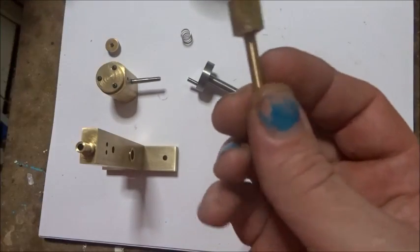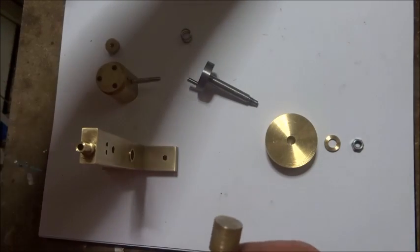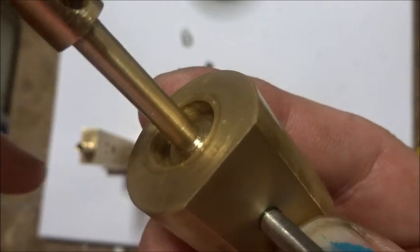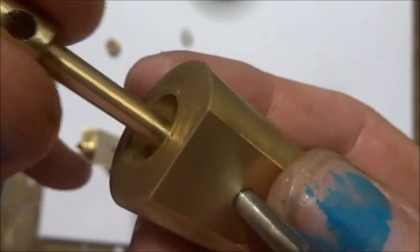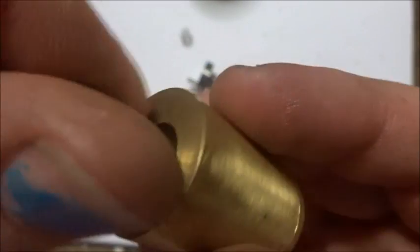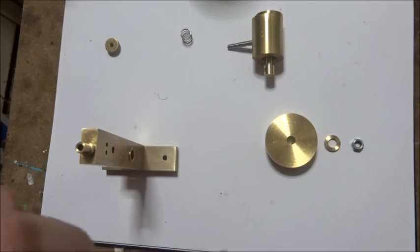The next job is to make sure this is nice and clean. I've got our trusty oil can here, so I'm going to give that a little bit of oil — just a drop of clean oil. We can push that in there, get some of that oil around — maybe even put another drop back in there afterwards. It should have good suction and it should be bouncy. Hold a finger over that hole — cylinder complete.